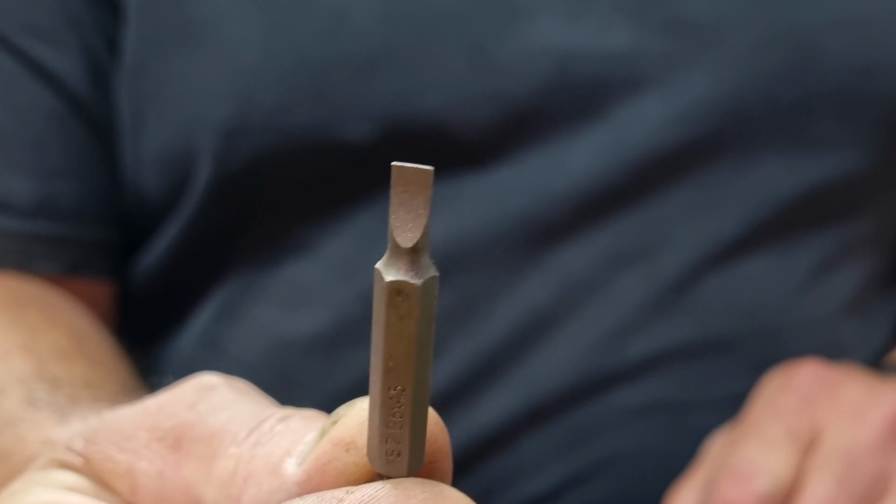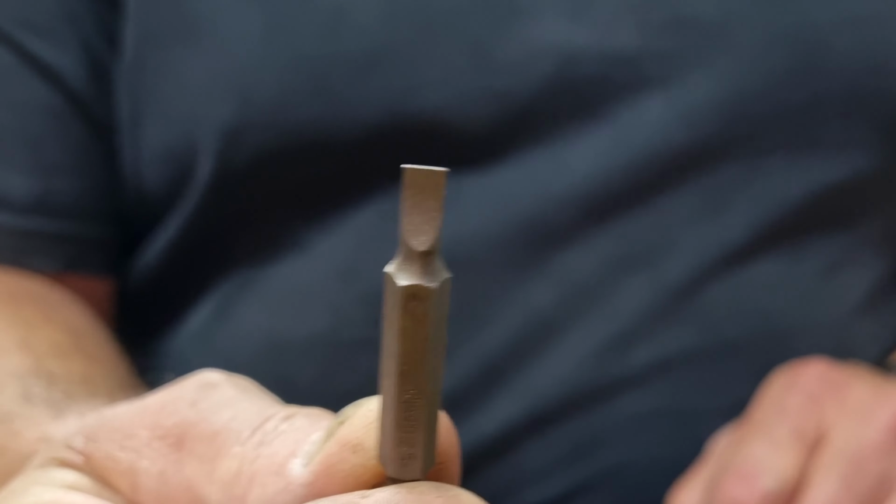You can buy tools which are manual tools. I use a drill bit, a plain screwdriver drill bit, and I grind the edges off on the bench grinder. So I put it in the drill and screw them down as I go around. And what actually happens is, as the spoke thread comes up through the nipple, it gets to a certain point and it just pushes the tool out. Now it doesn't really matter if that goes a quarter of a turn or half a turn past where the nipple thread ends, as long as that happens on all the spokes.